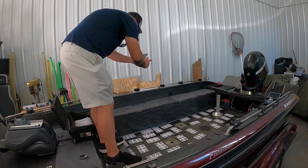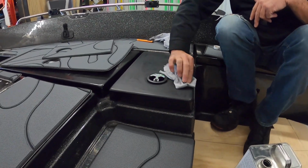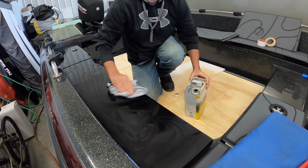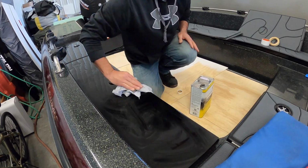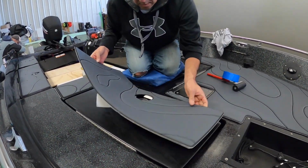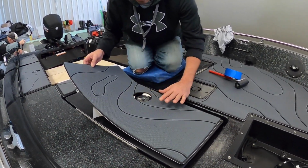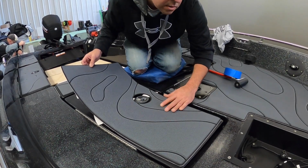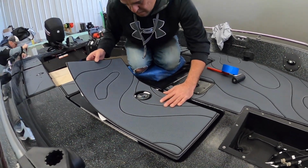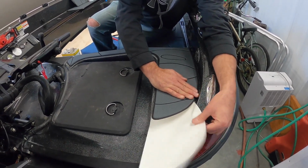You know, this flooring, it was kind of nerve-wracking when we had this going down. We had Captain Bob and Captain Chris helping with this. And really, it's very simple. Any of these kind of adhesive floorings, what you're going to want to do is flip that over, use a razor knife to just score the backing and just cut through that. And what we're going to do is peel back a couple inches in the center on each side of that and actually adhere that down. And that way we can kind of place the flooring piece without actually having the entire thing stick. So we can make sure that it's lined up real good.